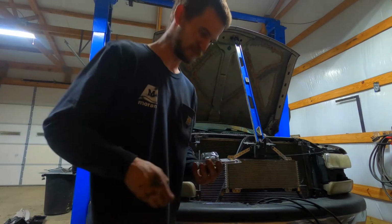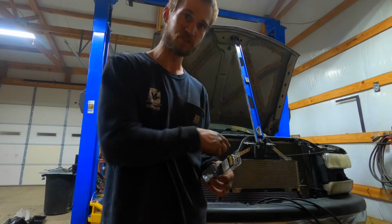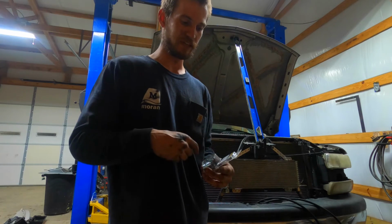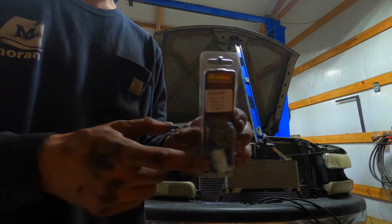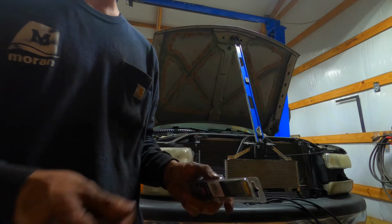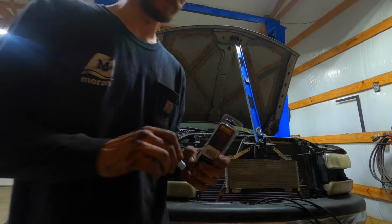Okay, so I didn't point this out earlier: to convert the cooler to 6AN line, because it's actually an inverted flare that's in the cooler these come with, you'll have to get these fittings here. I'll link this stuff down in the description for all these parts. Just thread one in each side, and that'll let you run a 6AN line on each one.